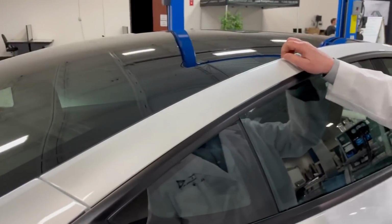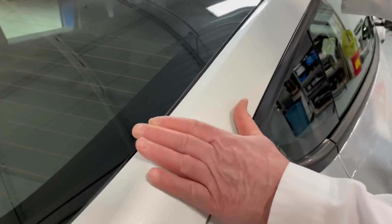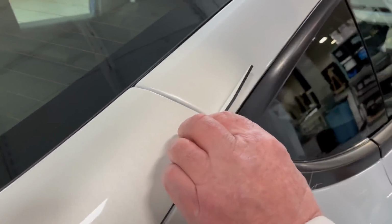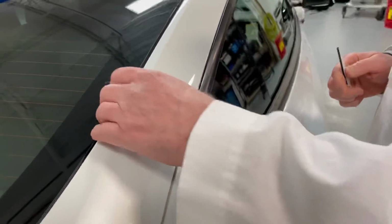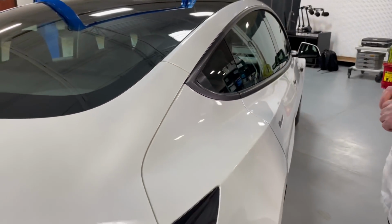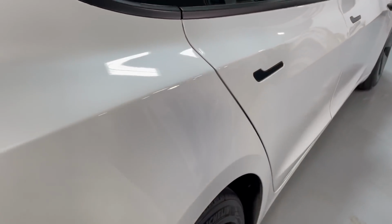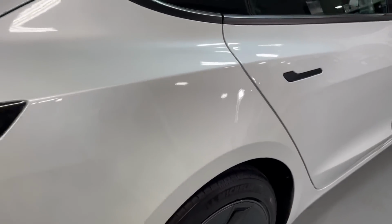So let's have a look here and see what's going on with the different aspects. That's flushness, it's not flush. So you take your little flushness gauge and you can see that it isn't going where it's supposed to. And this area right here still has a bump on it. We can go, and this is a big gap. This is kind of like the gaps you'd see on an off-road vehicle. My Jeep has gaps that size. That's just so you can wash the dirt out.